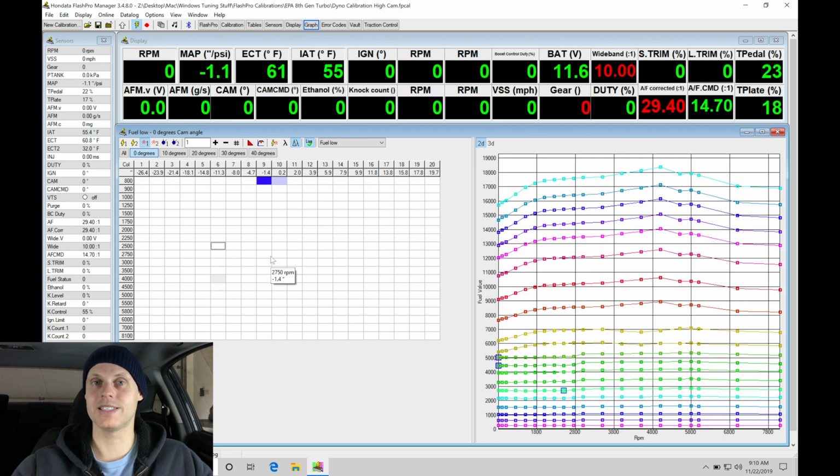We can't see that if we fire up the engine when it's, let's say, 60 degrees, leave it sit for an hour or two, and let's say it's a real cold day and it comes down to 60 degrees again. That is not going to be the exact same kind of condition, even though the coolant temperature is, let's say, 60 degrees in both situations.